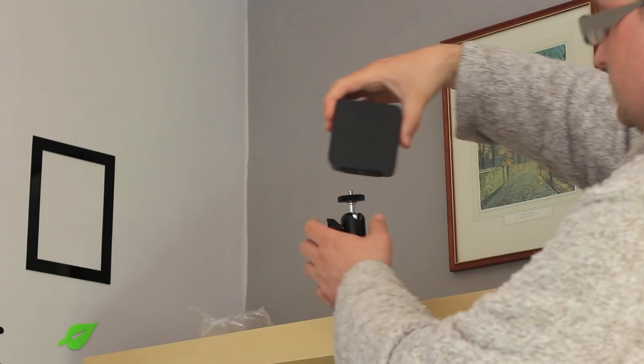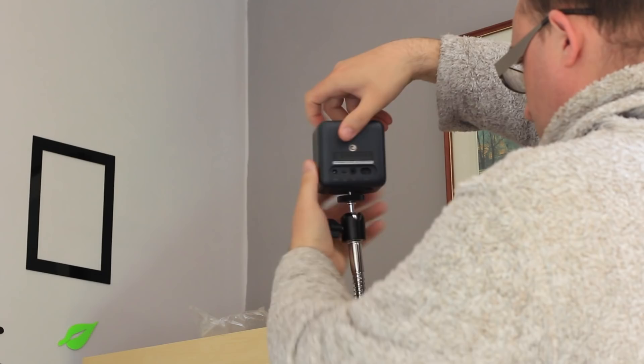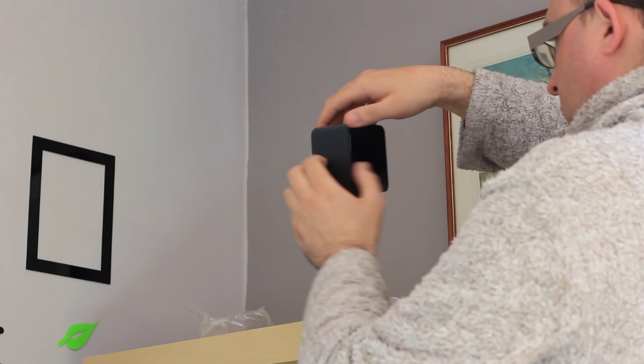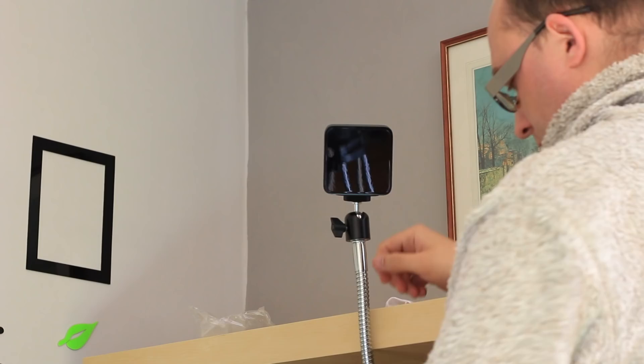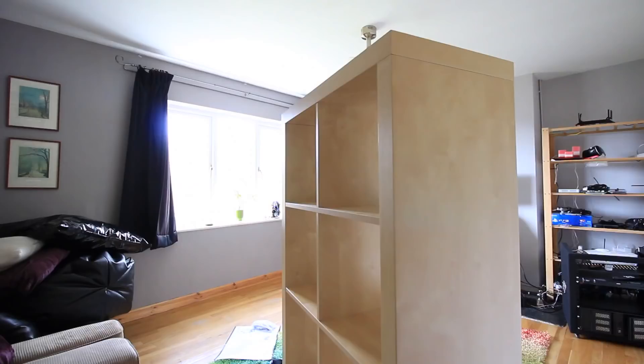Then finally there are two lighthouse base stations — little cubes that sit in the corners of your room about two meters off the ground, pointed downwards into either corner of your play space. They can be up to five meters apart, and this is how you define the square or rectangular area in which you're going to play. They come with two wall mounts if you're okay with screwing them to your wall; if not, they have a standard quarter-inch thread so you can use any kind of tripod or snake clamp designed for a camera. Each base station also needs to be plugged into a power socket. It took me about 20 minutes to get everything plugged in and set up, not including rearranging the room, but essentially it's not a huge undertaking.